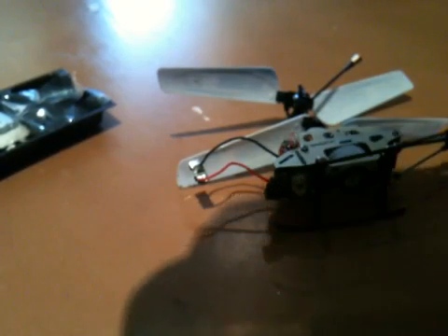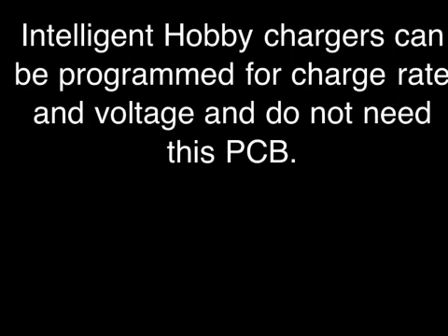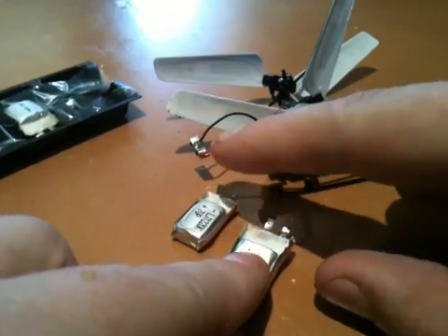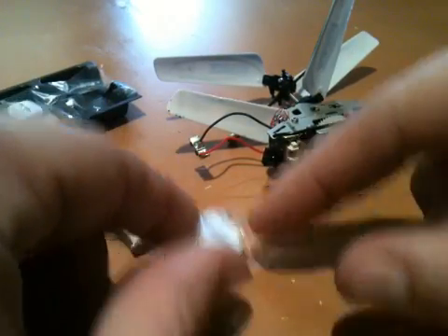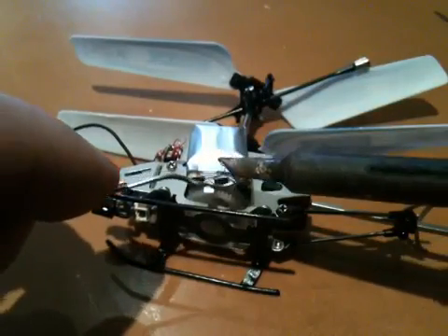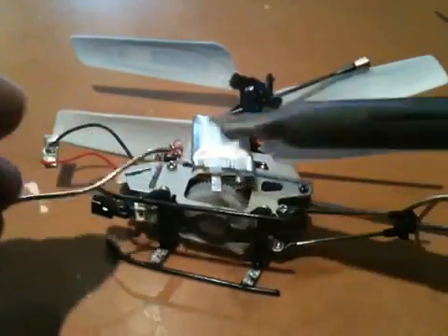The circuit board is there to protect the battery from overcharging. Typically the cells are marked positive and negative, but if they're not, make sure the red wire goes back to the same tab. Keep the battery upside down — this is the positive terminal. I'm going to tin these contacts and then get on with reattaching the PCB. This simple step is called tinning — it's where you add solder to the surfaces or wires that you're about to connect. Some people don't think it's important, but I feel it's very important.